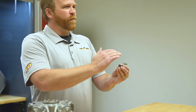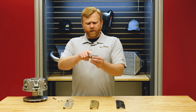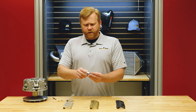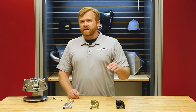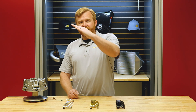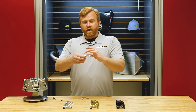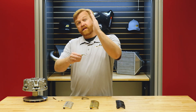The factory weight on the Can-Am is very flat — it has almost no profile or arc to it, so it shifts very linearly. The weight on the weight has a bump on the back. This weight is out of a 2020 RR and is a little different from the 2017 through 2019s, which had a bigger round bump that would cause the weight to engage and start upshifting really early in the RPMs, producing that slow feel at takeoff. We started messing with profile shapes to bring it up more steeply.